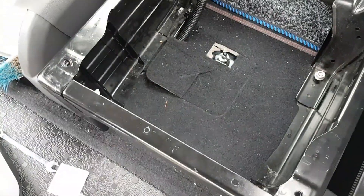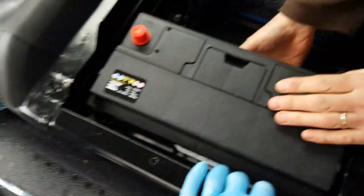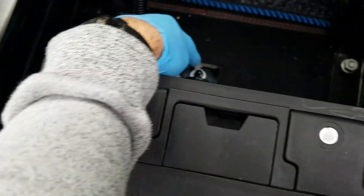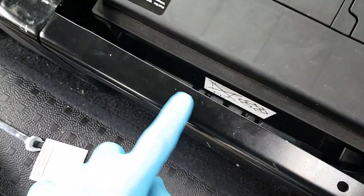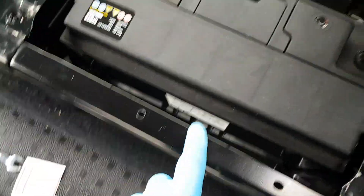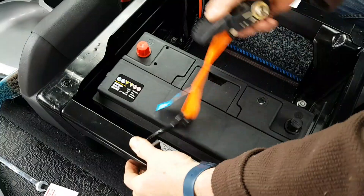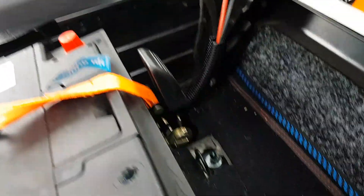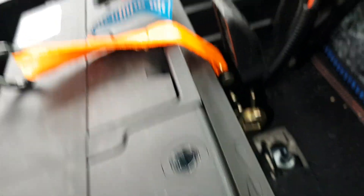The battery's going to sit in here. We found a bolt already going through the floor — VW installed. We put a D-ring on it and just drilled out an existing hole in the frame a bit bigger. The strap goes through the hole, over the top of the battery, around the D-ring into the ratchet strap, and we've got the battery nice and secured in there.